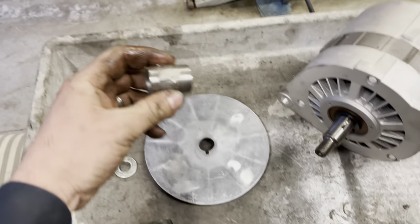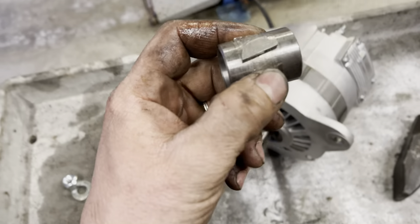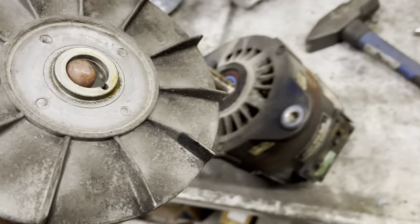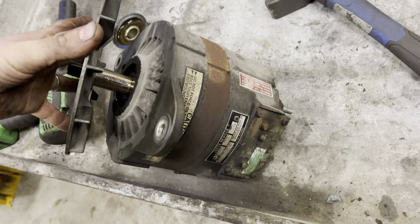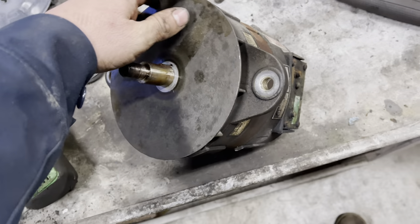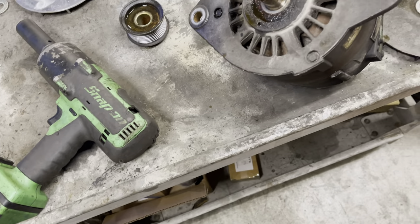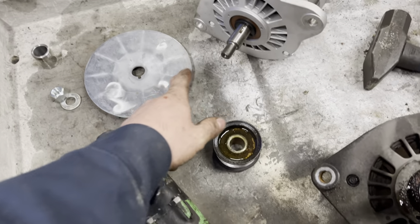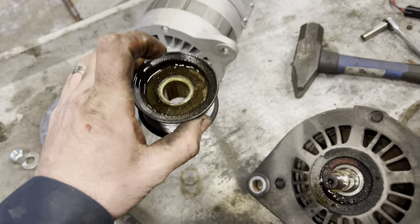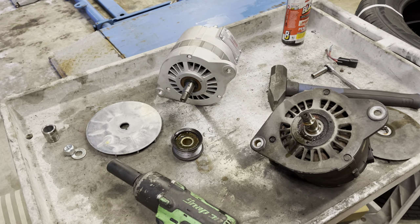Got a new little keyway here — I think it's just a protective shaft adapter. It was basically just on the new alternator with the keyway taped to it. That helps keep the cooling fan in place. This little fan just sits on it, and the keyway lines up there — that's what cools the alternator. It's basically the reverse order of how we took it apart: put the fan on first with the keyway, then put the pulley back on, clean it up a bit, put the nut on, and install it back in the RV.